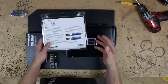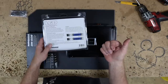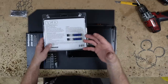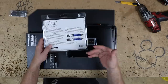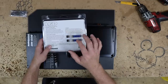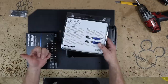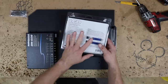And the reason why is because a lot of these radios have either Class D outboard amplifiers or Class D internal amplifiers. And when you disconnect the speaker, the signal coming out of the amplifier tends to get a little unbalanced, unhinged, and it causes a lot of high frequency distortion. So when you add in something like this, it's designed to put a resistance back into that factory amplifier and put it back in control. Seeing how this is a new car, more than likely it has a Class D amplifier. We're gonna go ahead and install these.